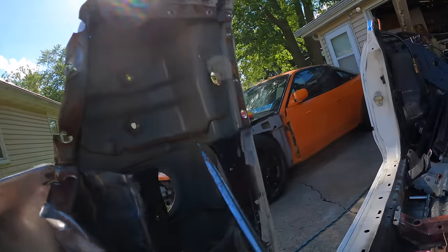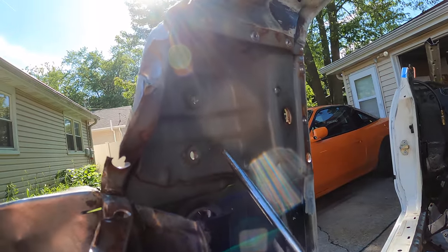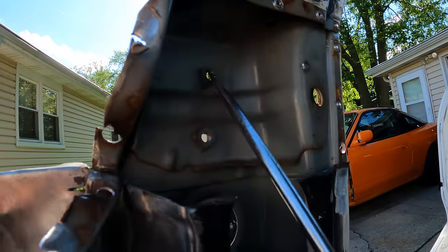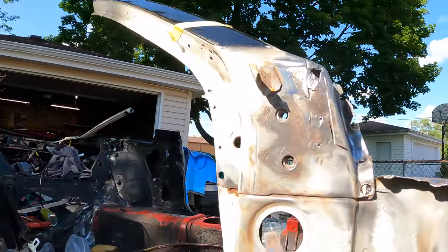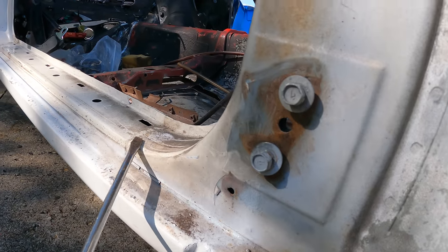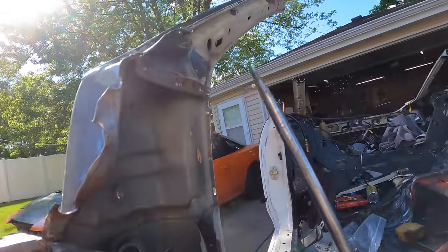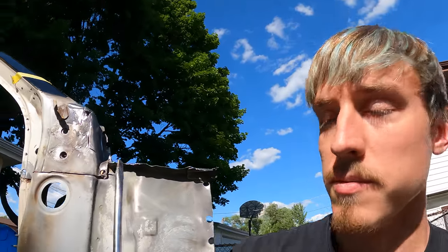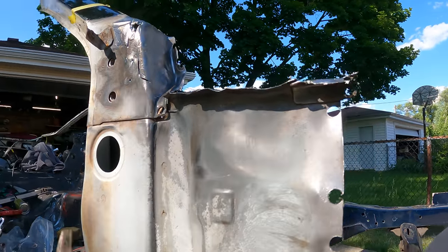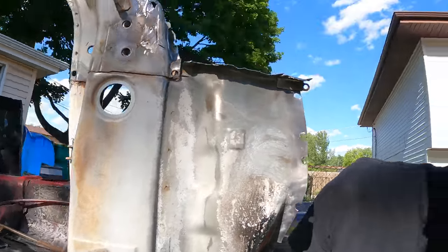I may have been mistaken about the layers here. I thought I'd be able to drill out some spot welds and separate this panel completely, but the reinforcement panel for the A-pillar and the door bolts is sandwiching with the outer piece, and there's another piece in the middle — it all goes all the way down. This whole piece is sandwiched inside and I don't want to drill all of those out. Instead I'm just going to cut along this seam right here. I'm not too worried about lining it up because I do have the door jig, which utilizes four bolts to connect everything.